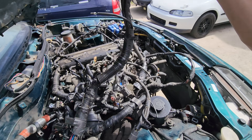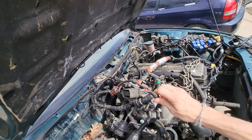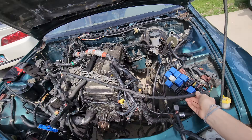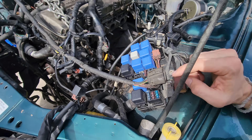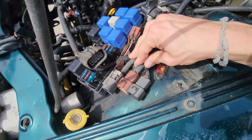These are going to be the most important ones — the three main engine plugs, and they attach right here. Now the KA has similar plugs, although not three, there's only two. These are the two plugs that go onto the KA harness. So essentially this harness is going to have to connect over here somehow. Originally on the 240 it connects on this side of the car, but what's important right now is to figure out what pins from these two connectors I need to line up to the pins in these three connectors.